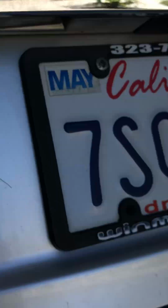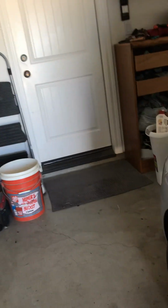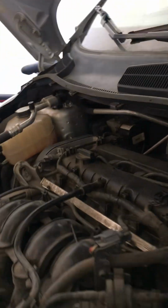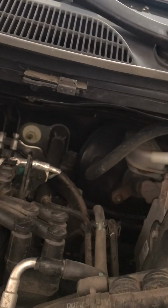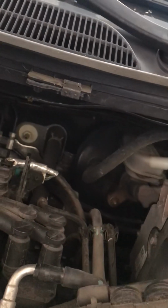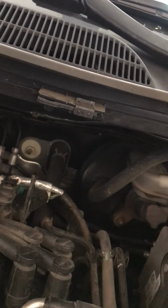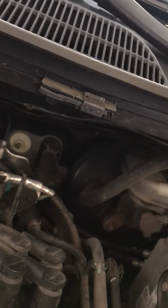So you're going to want to check all of these and try to find the leak. But most of all, you're not going to want to drive with that leak going on. So you've got to get the car serviced right away and have that leak checked out. And if air does get in, you're going to have the brakes bled, which is a bigger job. It takes sometimes about an hour, depending on the equipment they have available to bleed the brakes. But you've got to get all the air out, or the brakes don't work. They don't work when there's air in the hydraulic lines at all, or in that cylinder. So that's what I wanted to tell you.